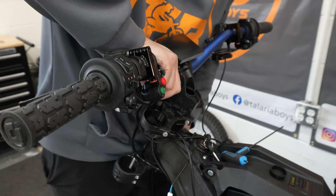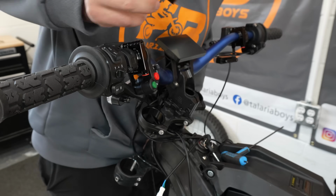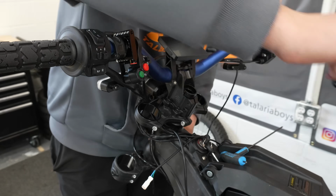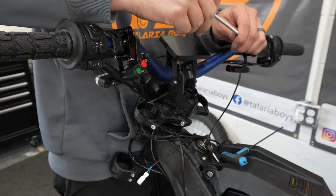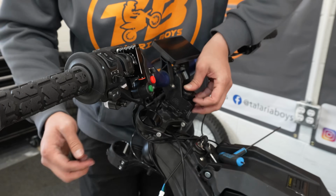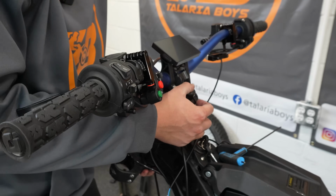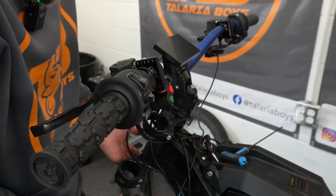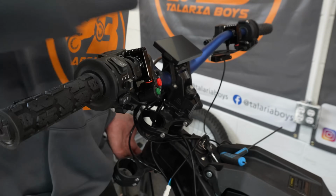And now the spacer is going to go right here, right on top. And now our stem lock is also going to go back in. The easiest way to put this stem lock in is absolutely to push the top part in first, hold it perfectly straight, and reach the bottom part in and screw it in. Otherwise, it's really difficult to line up.